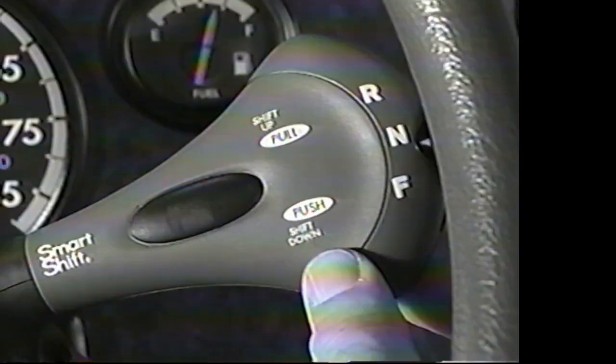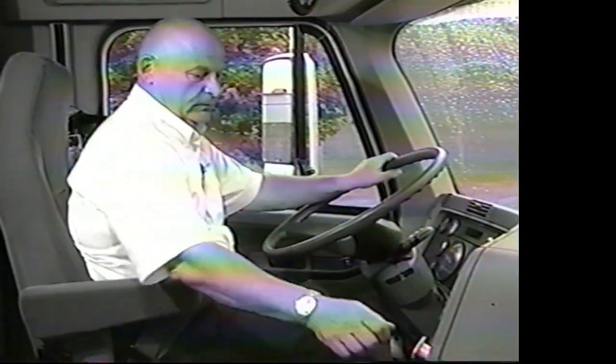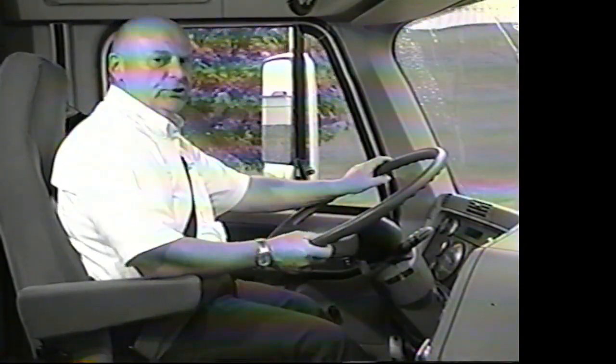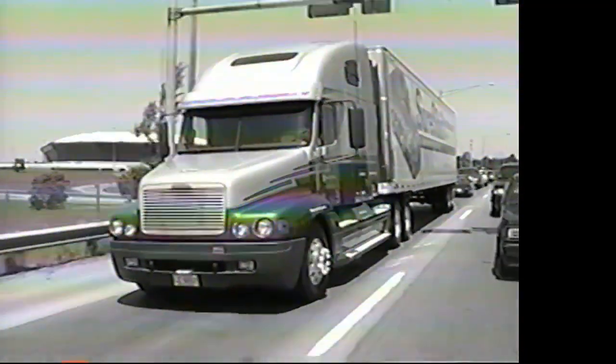The display will give you a CL and an N for neutral. To launch the truck in second gear, slide the selector to F for forward, put the clutch in all the way, feather it a bit, and you have second gear. Release the brakes and come off the clutch. This is the last time you'll use the clutch until you come to a complete stop.